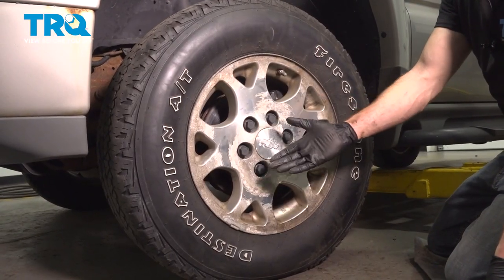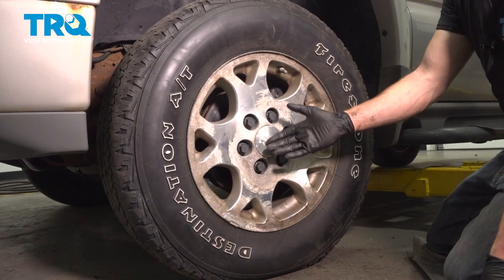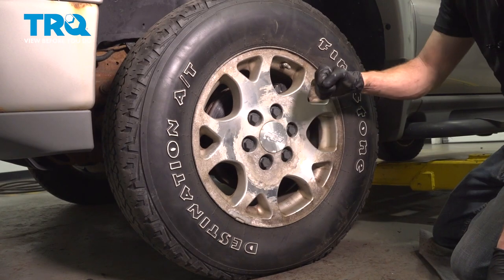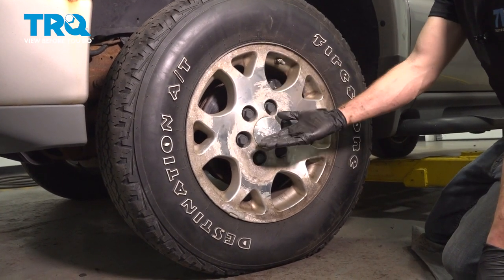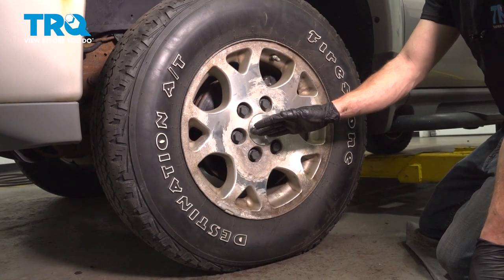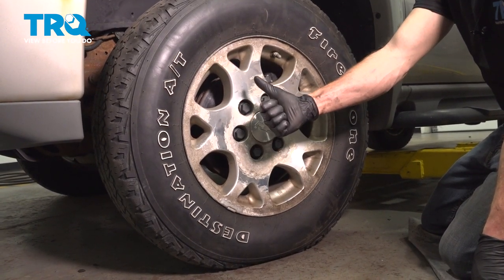Okay friends, we fully installed our front steering knuckle. At this point, you can go ahead and hop in the passenger compartment, pump up the brake pedal till it's nice and firm. Take your vehicle for a road test, make sure everything feels good, and take it down to your local alignment shop. Thanks for watching.